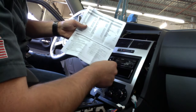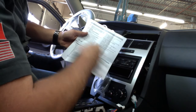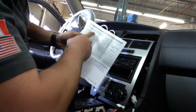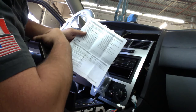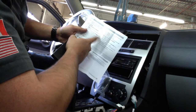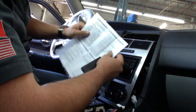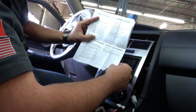I've followed the instructions. Page three covers vehicles without a factory amplifier; page four covers vehicles with amplifiers. The instructions note: this interface works with non-amplified, analog amplified, or digitally amplified models — follow the instructions carefully for your vehicle. Failure to do so may result in no sound or low sound. If you're unsure of your vehicle's factory amplifier, contact your local dealership, do some Google research, or contact your retailer.